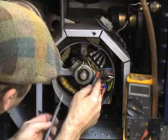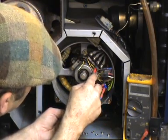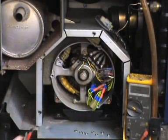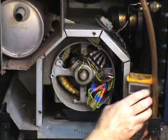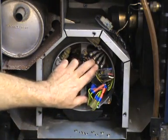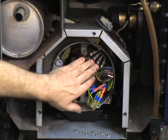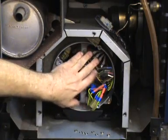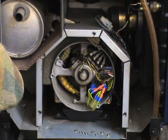That's all fine. And if you want to be a real purist, you can just check each one to earth to make sure there's no short to earth. If you did have a reading between these two, it's a sure sign that you've got a problem with the stator. Similarly, if the two values weren't the same, it would be telling you you've got a problem with the stator.